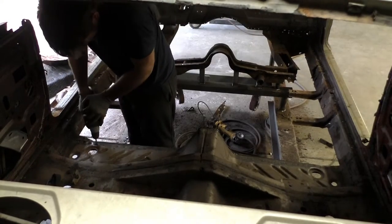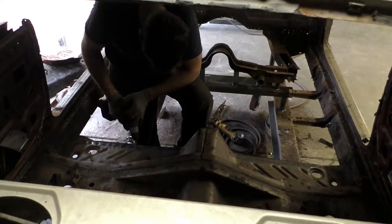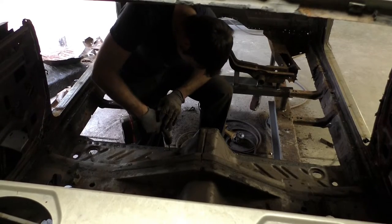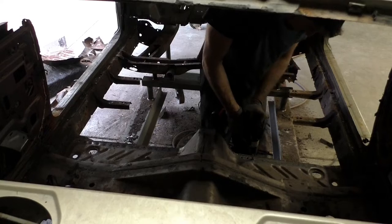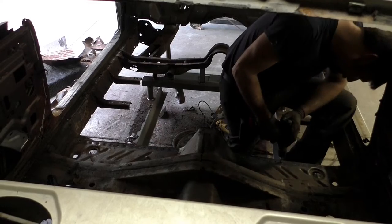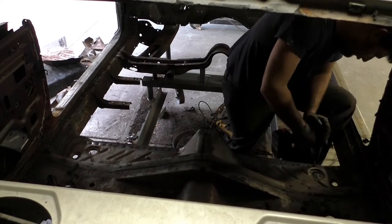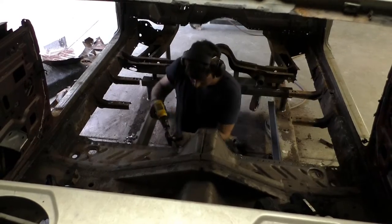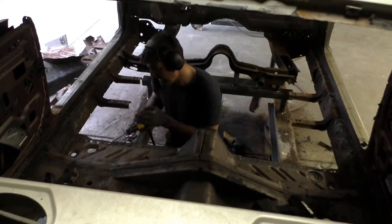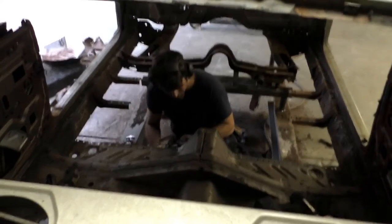I got the spot weld cutter out and put the air hammer away — we're drilling out spot welds. The reason we're doing it here is because these floor pans are the same gauge thickness and these spot welds are really strong. At this point I'm trying to save these rear foot wells as the owner wants to keep them. The main floor pan is sitting under this area, so the easiest way is to weaken the spot welds by drilling them out, then come back through with the air chisel and rip it right out with minimal damage. You can see how fast I can go — when it pops up we're not ripping anything, there are no marks left over. This is how to cleanly save a panel while separating two panels.